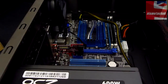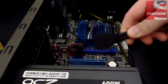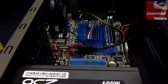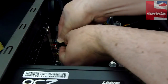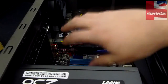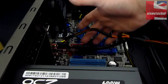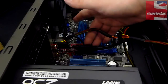As you can see, I've got the card installed into the case — quite self-explanatory. Grab your USB 3.0 header and connect that onto that end there, and then all you need to do is connect a SATA power connector up to there and that's basically it. Obviously you will have cables trailing across the motherboard area, so if you've got a side window you may want to consider how you're going to route them. But at the end of the day it's going to provide a USB 3.0 connector to the front of your case if you haven't got it on your board — which this particular board doesn't have — so this is ideal for you.